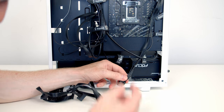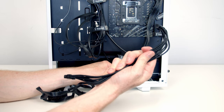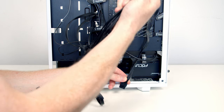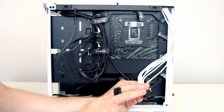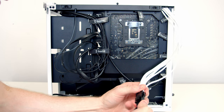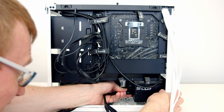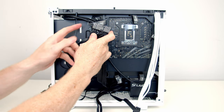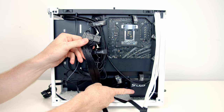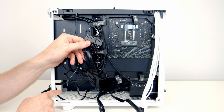I'm going to add a cable extension at the motherboard end of the cable, which means I'll need to remove the motherboard and add the cable back in. I decided to go with a white cable extension — we can plug our power supply cable into the cable extension and then we'll have enough cable to reach the power supply at the bottom. I also sized up our 24-pin cable and it's also going to be too short, so using an SFX power supply maybe wasn't the brightest idea in this case. I do have white cable extensions for the 24-pin connector and the GPU cable as well.